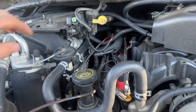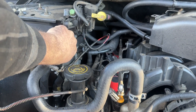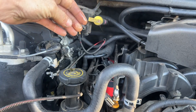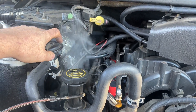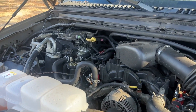I think we have a water-not-getting-hot-enough issue. So I took this heater hose clamp off - now that's warm water coming out of there, but it ain't nothing crazy. I'm gonna crank it up real quick and see if it shoots anything out of it - that'll let me know if there's a blockage or not.